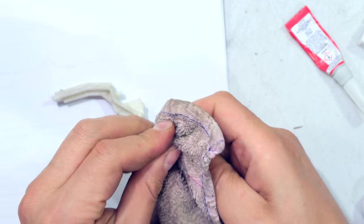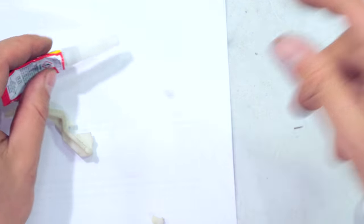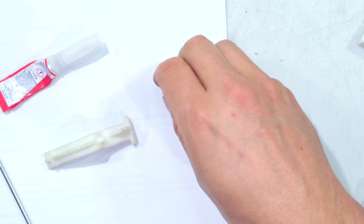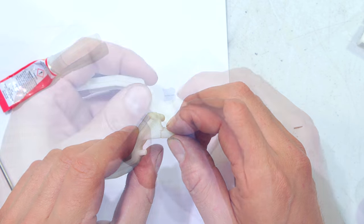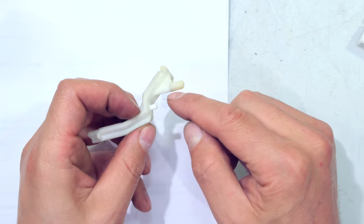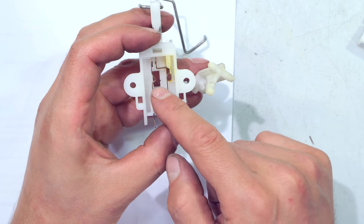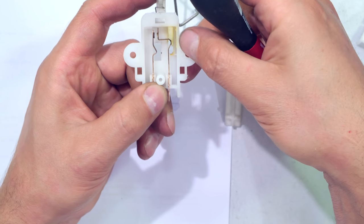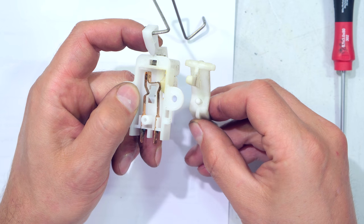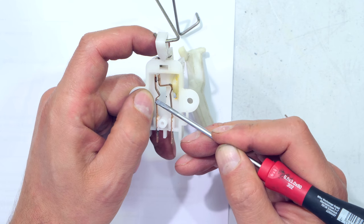I also clean my fingertips to ensure no oil. For the super glue, I put a little on paper rather than directly on the plastic — it tends to go everywhere — and I just paint it on and dip the piece in. The super glue holds it in place. To explain the mechanism: the lid is closed so it's in the normal position, but when there's excessive tub movement the finger pushes the switch open, and an open circuit tells the controller there's a problem.